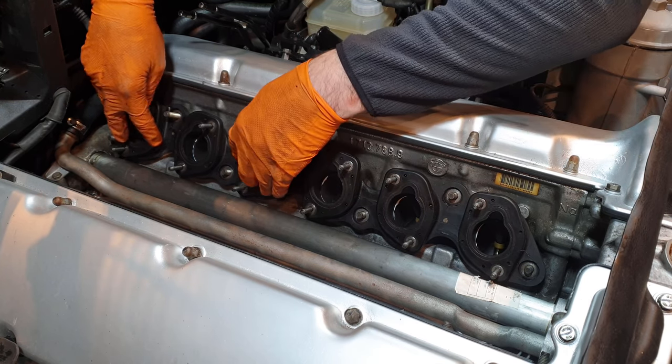The fuel rails themselves are just long hollow bars wrapped in a foil protective heat wrap — there's nothing wrong with them, no rips or tears. You've got the fuel pressure regulator sitting in a small cup at one end, fuel delivery coming in at the back, and a slightly elongated bar on one rail. Each clip comes off, the injector comes out, and the new one pops in. I'll clean up the external ones as well.